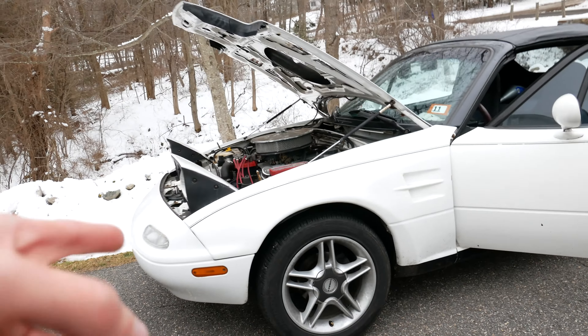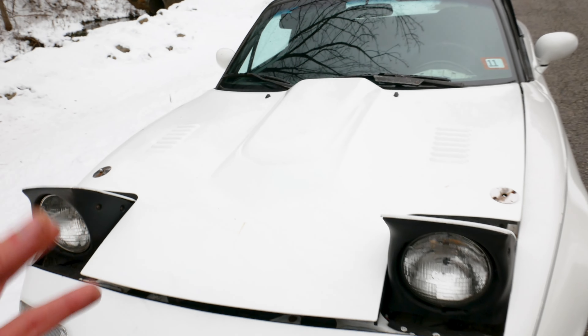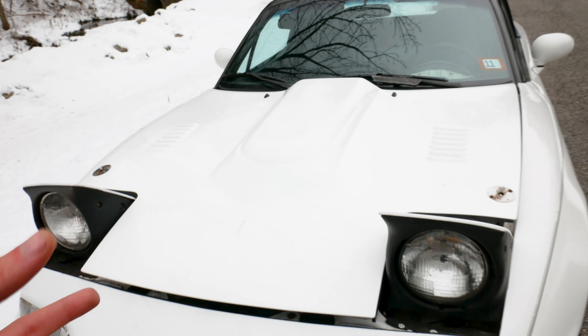This thing was done with a Monster Miata swap kit — Monster Miata mounts for the engine, a modified subframe, a modified oil pan, modified mounts for the transmission, and a custom diff mounting solution. It also comes with stiffer springs to match the little bit of extra weight. Based on everything I've read, this swap doesn't actually add a whole ton of weight — it's supposed to only add about 265 pounds to a Miata, so this thing is still a really light car, probably around 2,600 pounds.